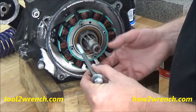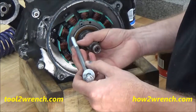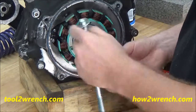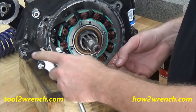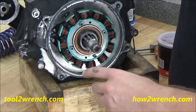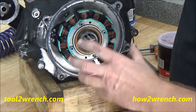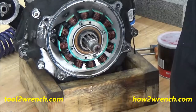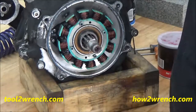Earlier I was talking about the other tool and how it was a little bit dangerous as you're threading those bolts in — this is what I'm talking about. If you go in there and you kiss that stator winding you're going to ruin it and you're going to have a bad day. So there are a couple of methods of how to pull that rotor off without causing any damage. Use the tool properly. You have to determine what's going to be best based on your current crankshaft and spline condition. Click on the links below in the description for how to purchase these tools for your own shop.